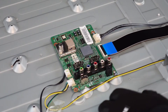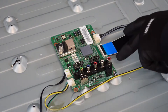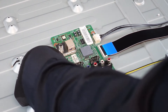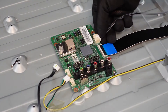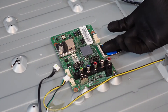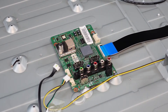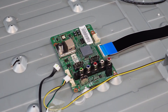We're gonna start with the main board first. There are just three plugs here plus the ribbon cable connection that we're gonna get out first, and then we're gonna pull these two screws off the board and it should pull away from the back. You just want to pinch on the bottom to where the latch comes up over the plug — they should just come right out. Same thing with this guy. For the ribbon cable connection, you want to get your fingernail underneath the flap and pop it up. These should just ease out of there. We can get the screws. Should be it for the main board.